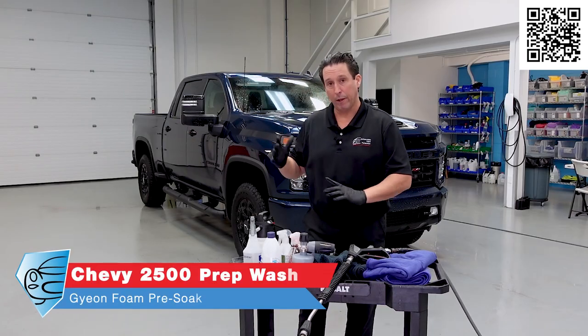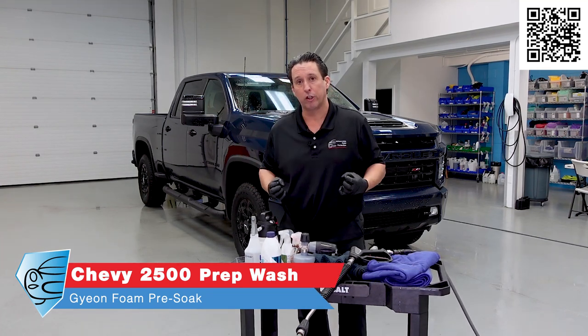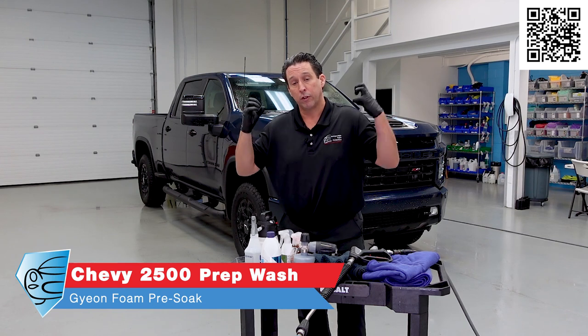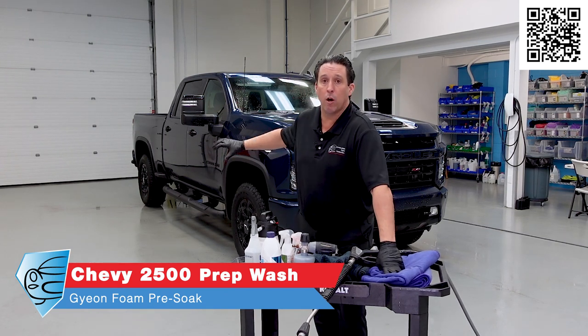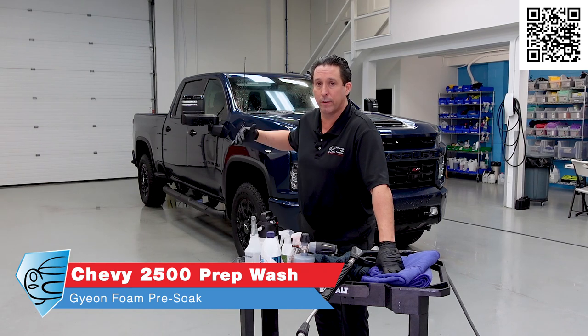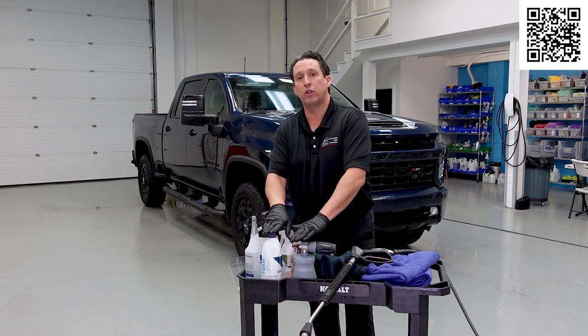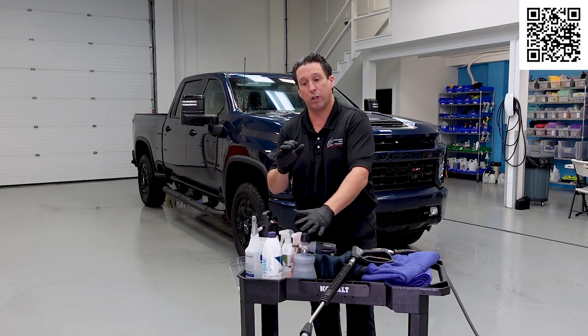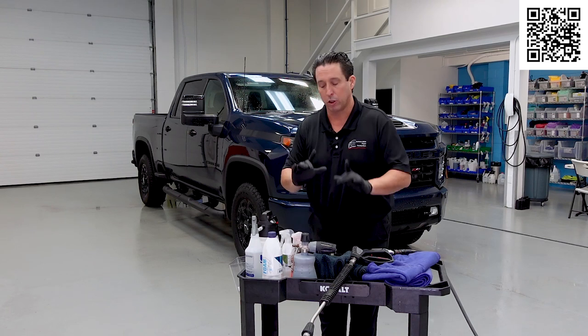And since it's sitting up now, we can talk about the foam. We're gonna foam the vehicle down first. It's essentially a pre-soak, so we wanna let the soap break up all the dirt. A truck like this has been off-road, down this road, on construction, in the trades. You wanna keep it clean, but you wanna let the pre-soak, the foam, break up all that dirt, and then we're gonna wash it off with a pressure washer before we start touching and potentially swirling it up.